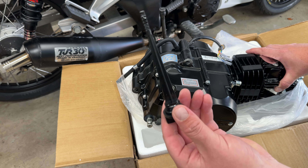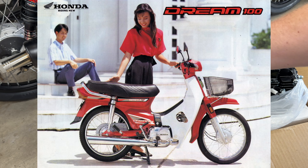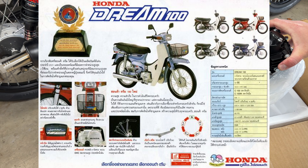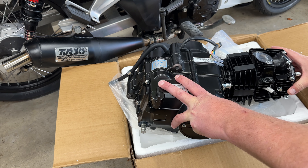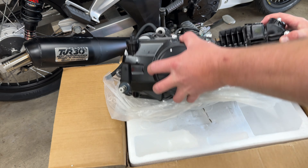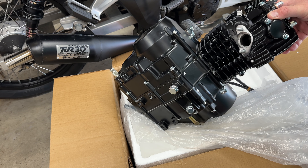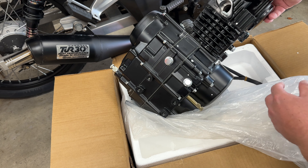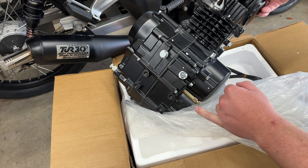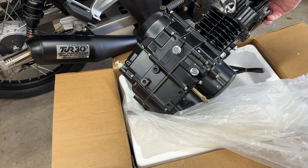You've got your oil dipstick here. This is supposedly a dry engine — it's got a little bit of residue on there but there doesn't seem to be any oil. These were essentially copied from the Honda Dream 100 engine, or the Honda EX5 engine, and they just got turned into bigger capacity. These were Lifan-made Hondas under license at one point. This spark plug in there is some random brand — rip that out and replace it with an NGK if you can. On the bottom you've got your exhaust exit there, and it's got studs, which is nice. The flat bolt on the bottom is the oil drain. You've also got your cam chain tensioner spring under there — don't take that out if you don't have to, it'll just go boom. And then you've got your four foot peg mounts as well.